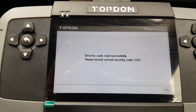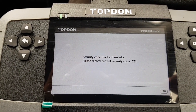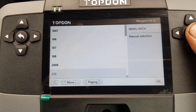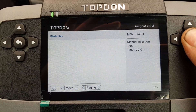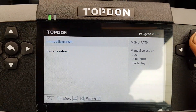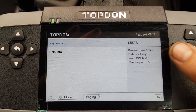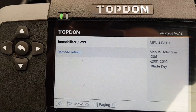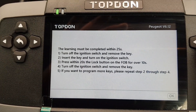I'm going to see if I can find one more thing to look at and then we'll call it a day. I'll spin off some more key programming videos in the future - I want to get some keys to do. Just a quick one in between: I'm in an old 206. I don't think it'll be able to pull the PIN on this - you used to have to cut into the CAN wiring on these and read it out separately. There's no PIN read on this, just the key learning. But you can see it says delete all keys - read PIN first. This just does OBD, so that's fair enough, that's all it claims to do. Remote relearn - at least there's plenty of information on there.